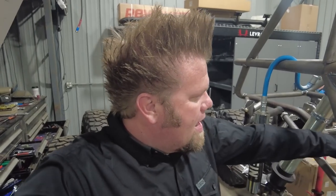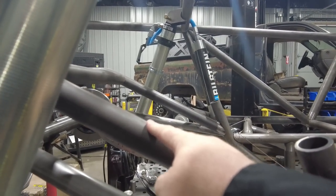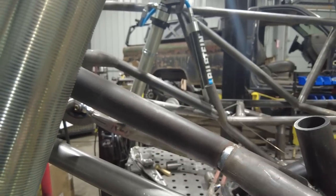And then the radiator, he actually mounts perfectly flat back here on the chassis, and then puts a fan and a shroud on the bottom side to protect it from debris, and I'll do that later. I think one thing I might do is, instead of adding tabs to the side of the radiator to basically make it mount onto this tube, what I might do is actually just bend a piece of aluminum and make it so I actually mount it using some either heavy duty hose clamps or maybe some T-bolt clamps.